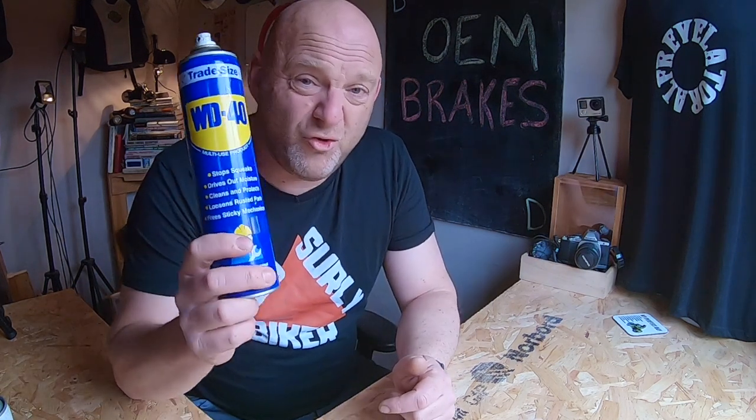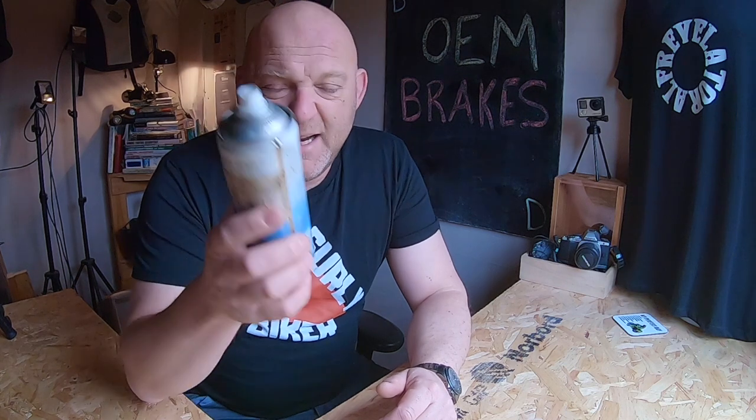Here's another free tip to improve your braking efficiency: get some brake cleaner and actually clean your brake discs. Lots of people overlook this. Don't use WD-40 — that's one sure way to end up in the morgue. You need a proper brake cleaner from your motorcycle parts supplier; it cleans and evaporates pretty much as soon as you apply it. Wipe it off with a rag and you're good. Having clean brake discs is really going to help you.